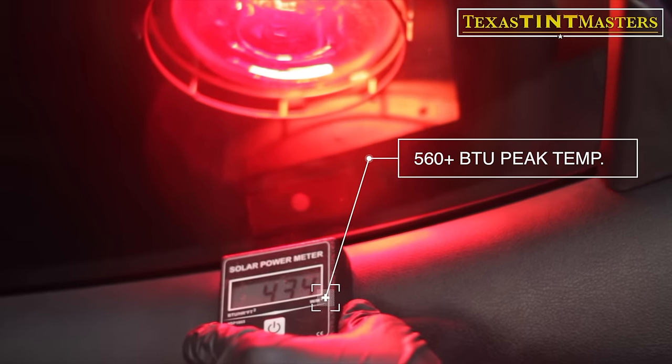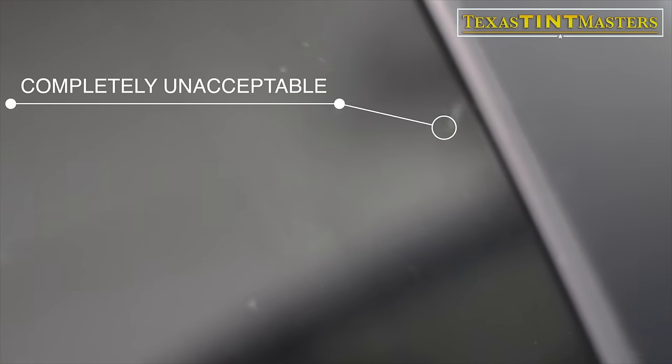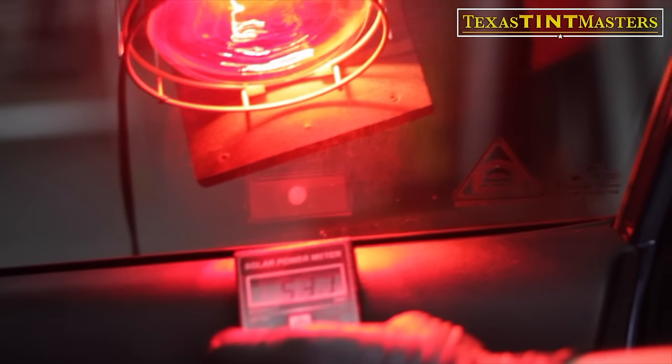This tint is allowing 400 to 500 to come through — that is not very good at all. And as I have my hand here, I can feel the heat emitting through this. This is 5% limo tint brought in from one of our competitors. As you can also probably see, this was not done very well at all — it's got creases and dirt on it. Now this is the front 35% right here, this is what you'd get on the legal front windows. Putting this light up here, it exceeds the highest amount this meter can possibly read.